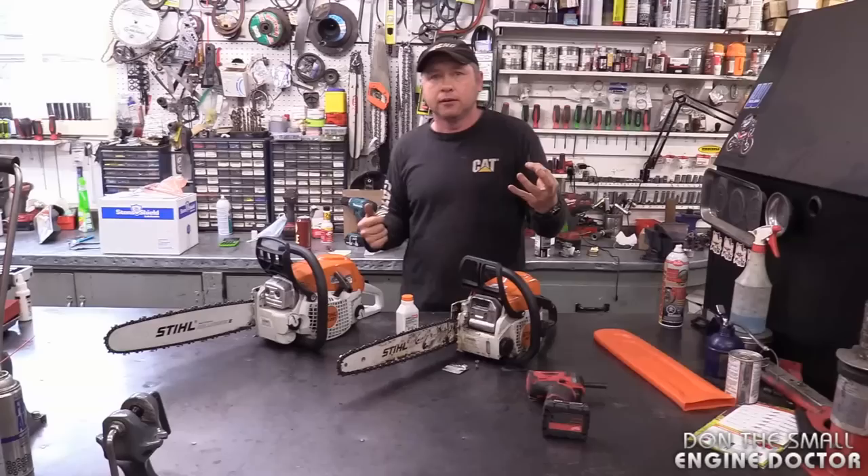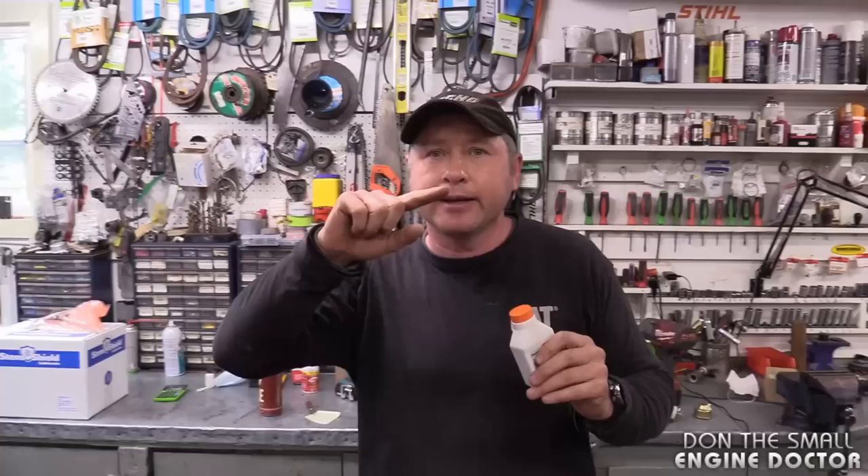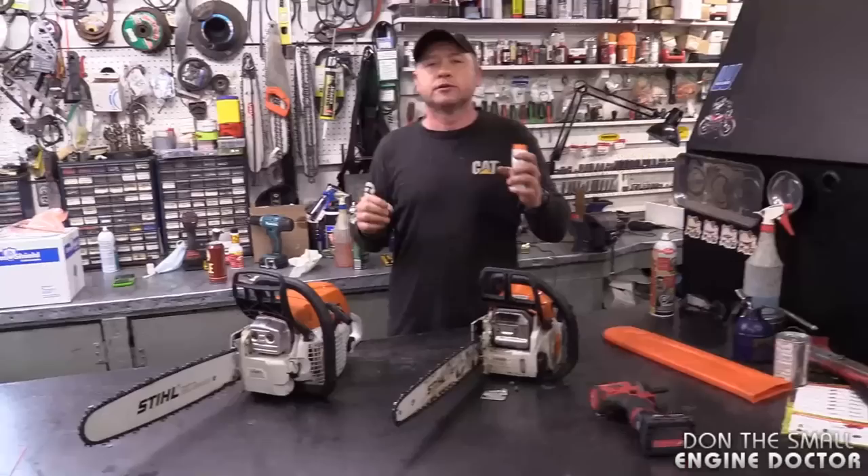If you can get air in still — like if your air intake side was clean but your exhaust side is plugged — it's just going to overheat. Here's the kicker: if you use too much oil, you'll get a huge carbon buildup right on the piston and on the exhaust port. It's just getting plugged up and it can't do what it's supposed to. I do have a video on that where I had a chainsaw in the shop where the exhaust port was plugged — I'll put the link under the video.